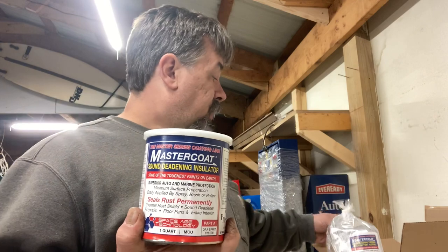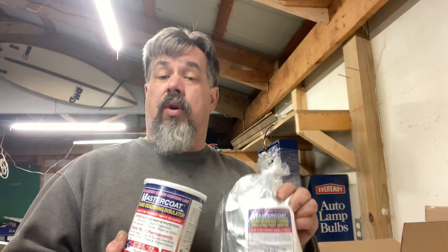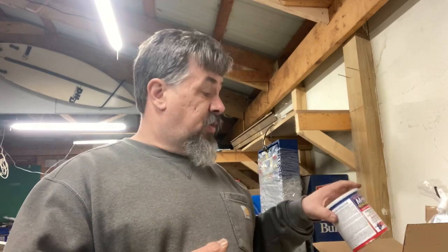Or it's an area that's going to get sanded and top coated. I've got a very good friend who has a body shop — he'll use this product and then do his body work on top of it. This is a moisture-curing paint, which means the moisture in the air cures it and makes it hard. It will get rock hard. But what he sent me today is a new product — you mix these two together and it becomes a sound deadening product combined with the silver paint.